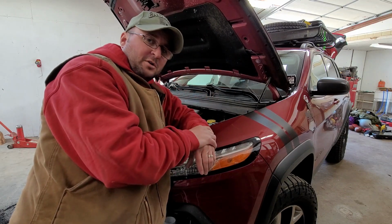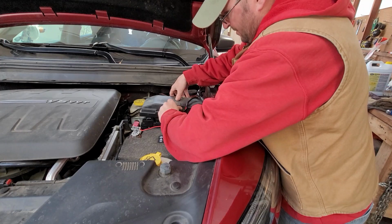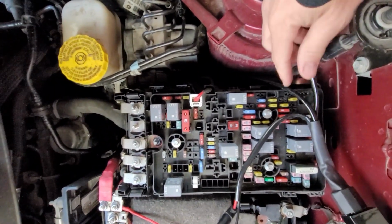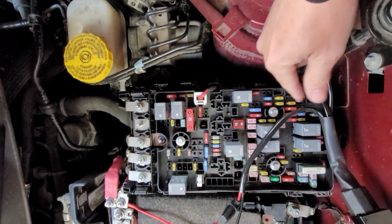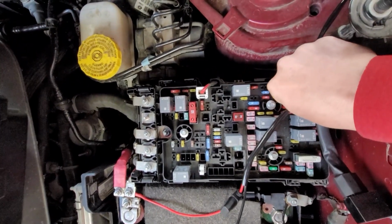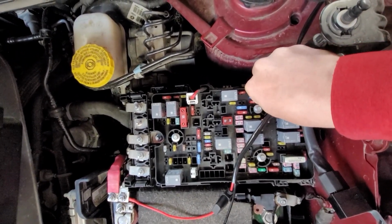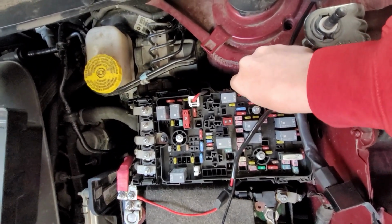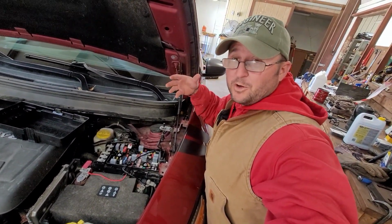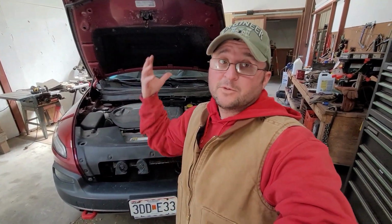So what you can do is change a fuse in here. I'll move you up here, see if you can see it. In your fuse box, all you gotta do is swap one fuse out. Looking down in here, this fuse right here is gonna be F91. What we're gonna do is pop F91 out. There. We're gonna move it over one spot to position F81. That's it. That should be on full time now. So F91 to F81, and that'll turn your rear 12 volt to full time power. Okay, so if you're interested in doing that, that's how you do it.